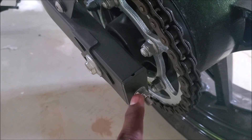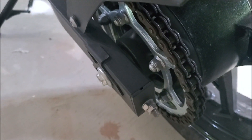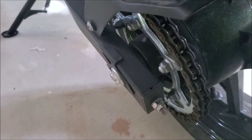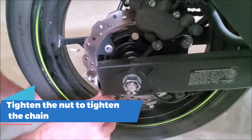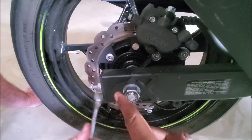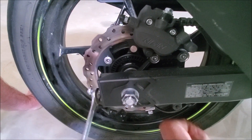In order to do that, we have to loosen these two bolts — same on the other side — and pull it back. Actually, we have to tighten these two: loosen the first one and tighten the second bolt so it'll go farther in. So the outside bolt — just loosen the nut and then crank it inward. If you crank it tight, the chain is going to get tightened as well.